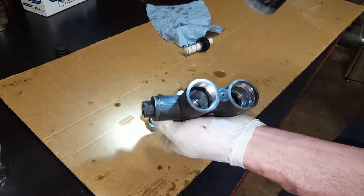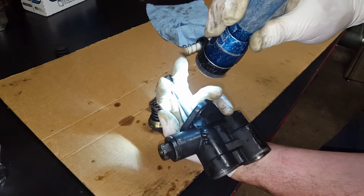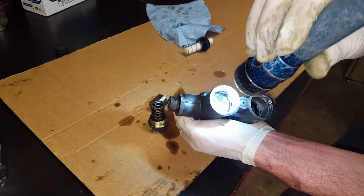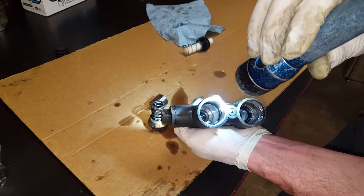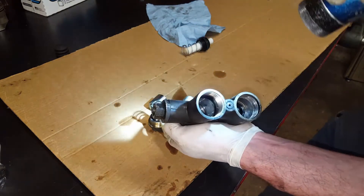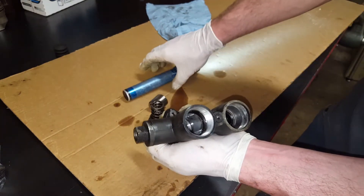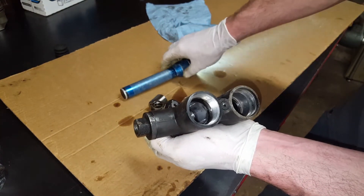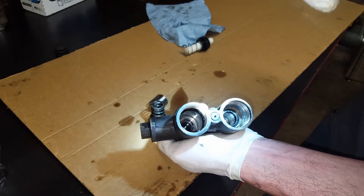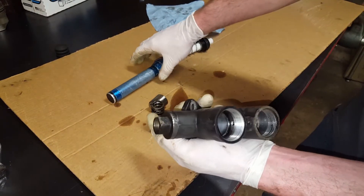I was wrong — there's not actually an O-ring that seals diesel fuel from getting inside your crankcase. It's a double-lip seal; it actually has a spring on it on the back there. That's definitely one of the failures that could happen. If that seal failed, you'd be pouring diesel fuel inside of your crankcase. And if the seal failed on the bottom, then you'd be leaking diesel fuel on the ground.